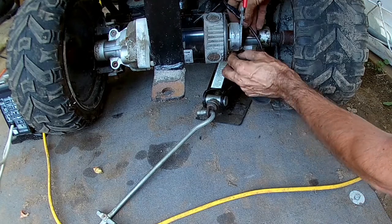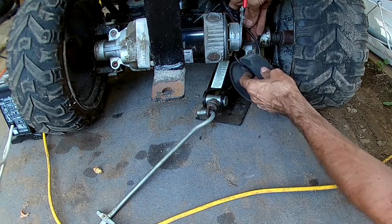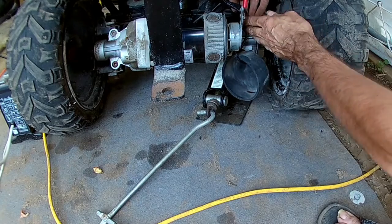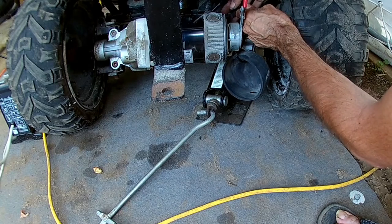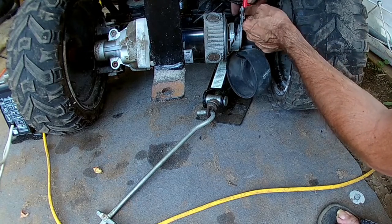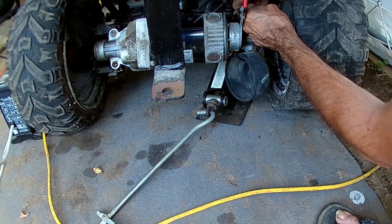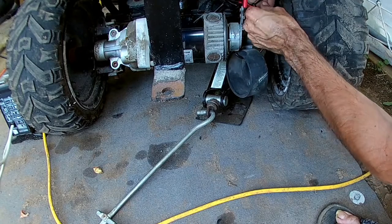I can't check this wire, or these wires, because they go into the brake. Oh, they're wired up to the switch. They're good there. Yeah, as you've seen before, I bypassed the switch with a fuse. Just connected the terminals together to make it kind of permanently closed circuit. I'm going to put the tester on it. Okay, it wasn't the switch, sorry. I finished what I was talking about. That might be the error code 9 right there. The wire has come out.